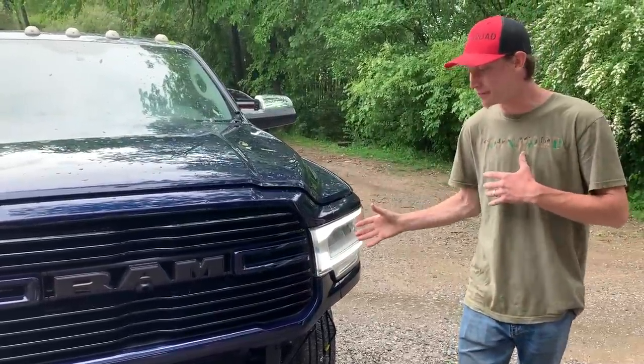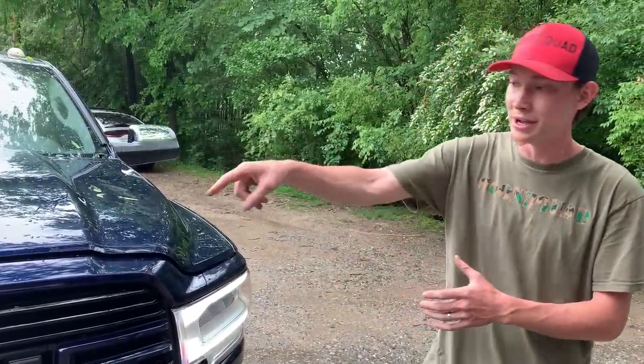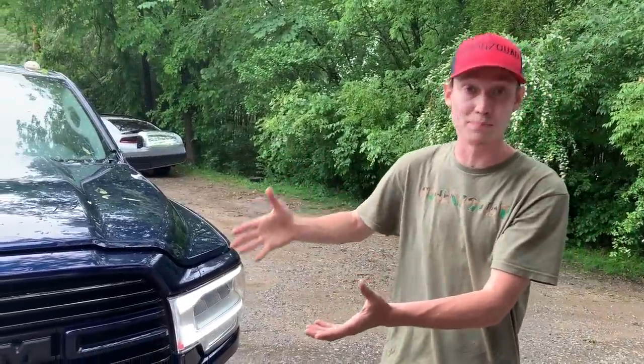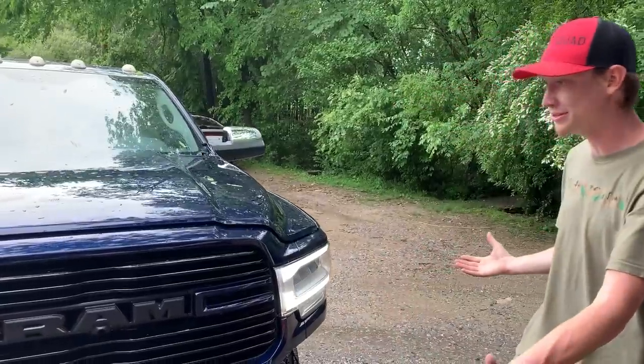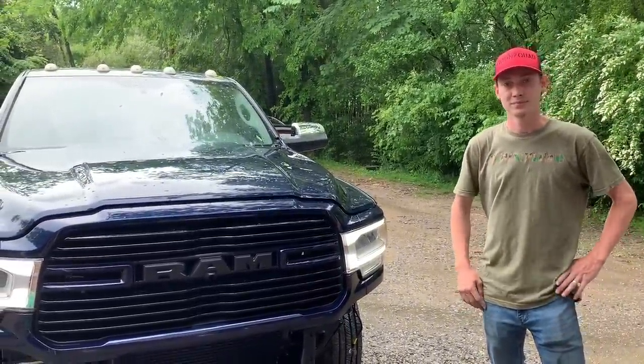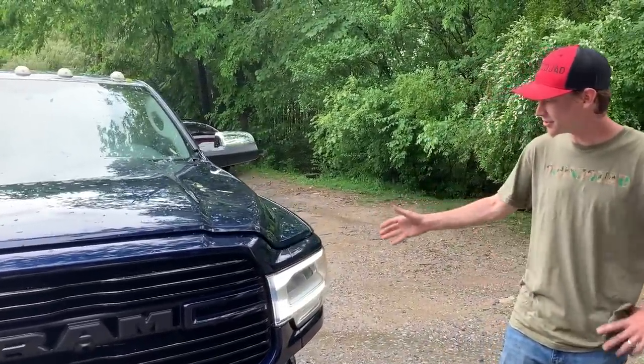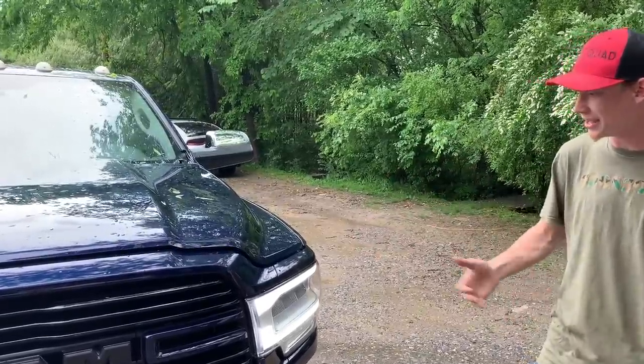And we actually made them both a lot brighter, because whenever we wired this one up, the DRL was just way brighter than that side. So I went over there and swapped two wires, and it just brightened them up just the same. So now they look way better, dude, brighter. Way better. Used to in the daytime, you wouldn't be able to hardly see them, but now they just pop right out at you. Looks really good. And everything else works, right? Yeah, turn signals, high beam, low beam, all that good stuff.